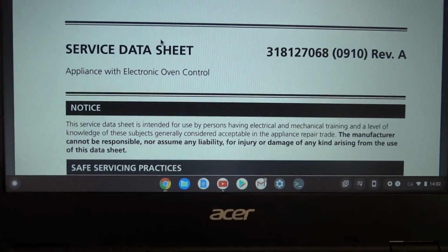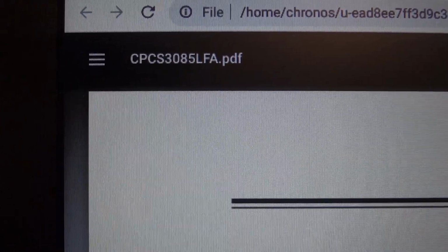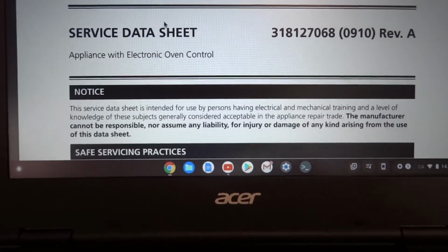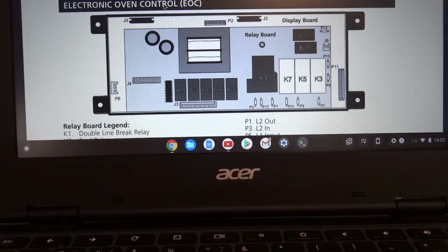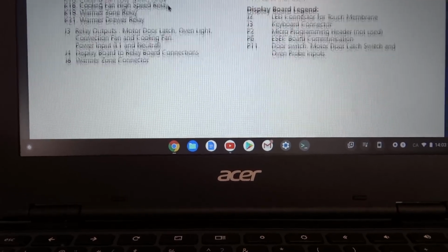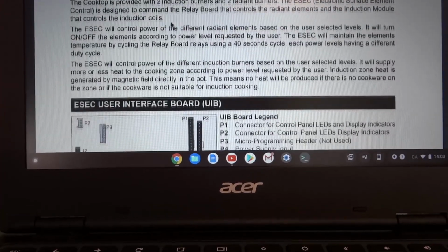Okay guys, so I found a very useful document for my model, and the file is called exactly like the model number and .pdf. So if you have a different model, you might try to check on the internet for a similar thing. And if we scroll down, we can see some description, the names of boards as well, some connectors, names, what is connected to what. So it might help you to troubleshoot that. I will put the link for this file in the description.